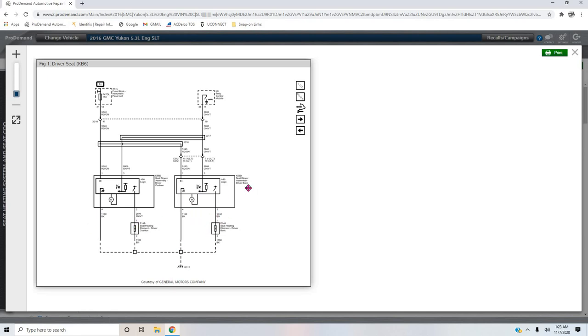But if we know passenger side is working, and we do that measurement and we compare it to our driver's side and they're different, it pretty much narrows it down. Considering we know that, this isn't passenger side, I'm just using it as an example, but since we know that there's so many other things sharing this 311 ground, we've got to assume the ground is good.